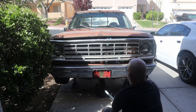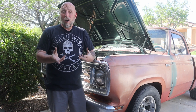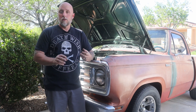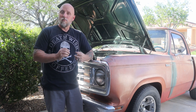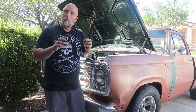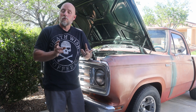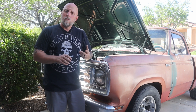When people talk about suspension, they often talk about the springs and the shocks, brakes, but things like the sway bar mounts, the sway bar end links, or in the case of these old trucks the strut rods — things like that often get overlooked. So when I was underneath this thing doing the front lower control arms, I noticed that pretty much all the rubber mounts — where the sway bar mounts, the strut rods, even the sway bar frame mounts — were pretty much gone.